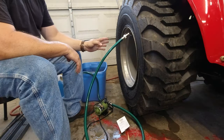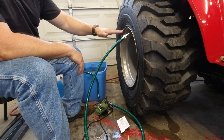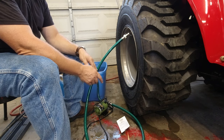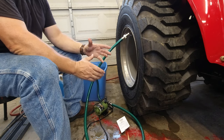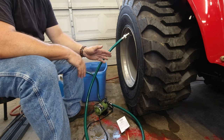Let's recap what happened: I released the air pressure out of the tire and let the jack down to compress the tire, but the Carlisle tractor tires — with this bead protector — have such stiff sidewalls that it broke the bead loose from the rim. That's not a good thing.